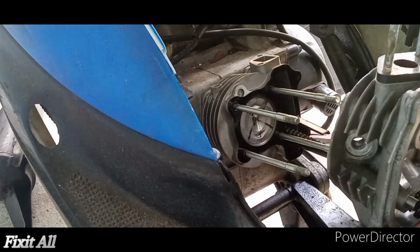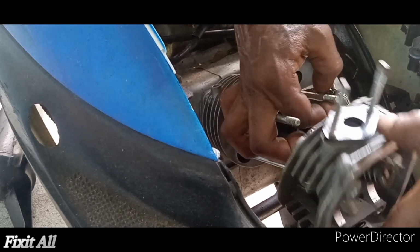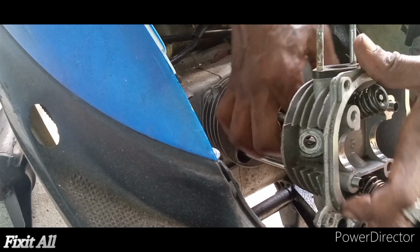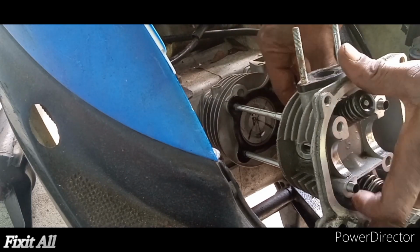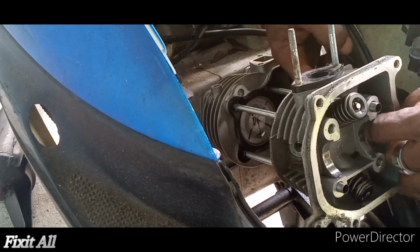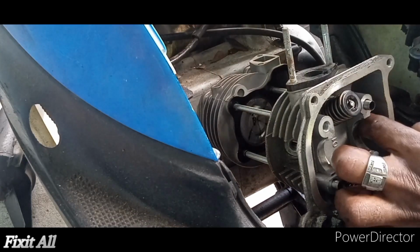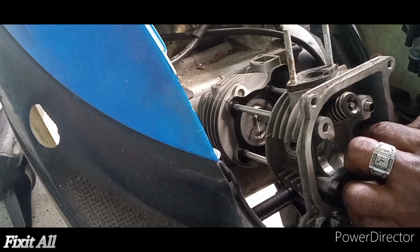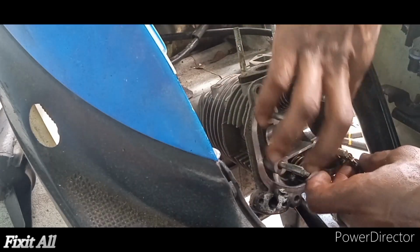Cylinder head. Now we need to get back our cam chain through there again, guys. And my advice, try to tie something on there so it's a bit easier to pull through. But you can definitely use your fingers and work your way, or use something to hold it at least. Make sure our cam guide and everything is lined up properly. Then we can get down our head. And here we go, guys.